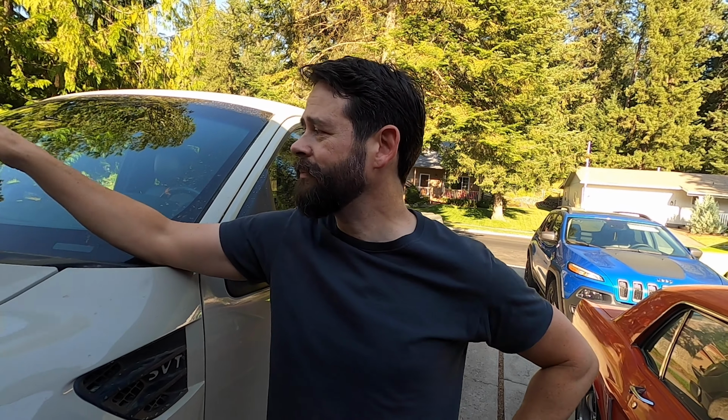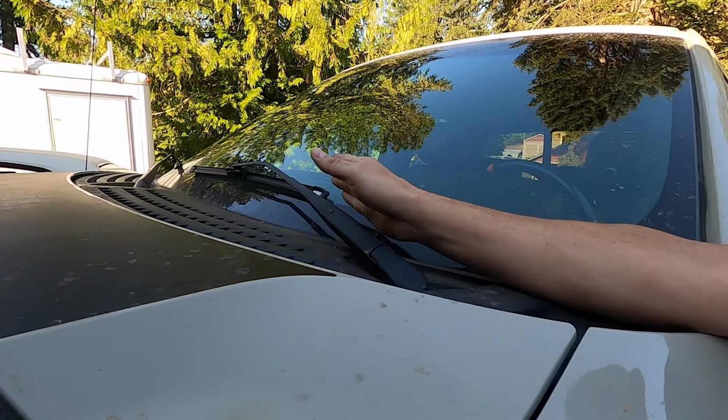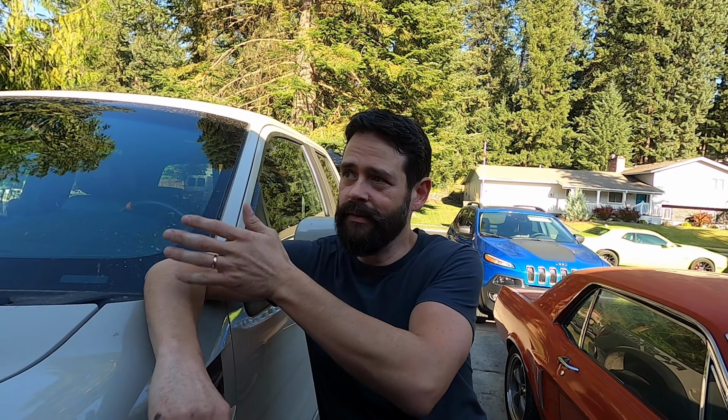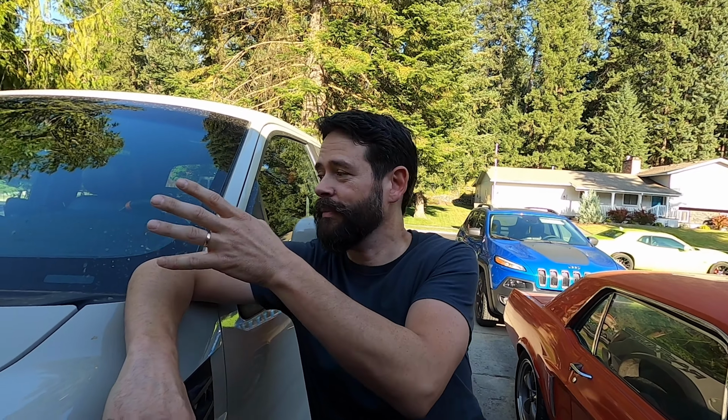It's two things. Number one, let's talk about the wiper motor because when you push the button in here, after you turn the wipers on, which the wipers work just fine, the motor works great, but you want to spray, you want a little spritzing of the window and it doesn't work. And you think, well, it's probably the wiper motor, or not the wiper motor, but the sprayer pump. Is that what you call it? The pump? Pump motor. The sprayer pump motor. You think that it maybe burnt that out, or it's a fuse.